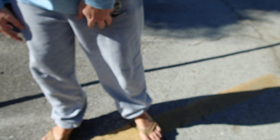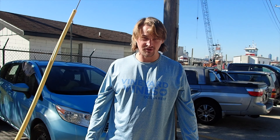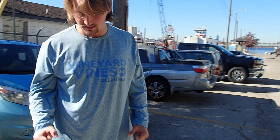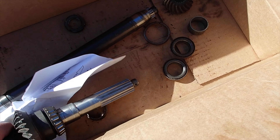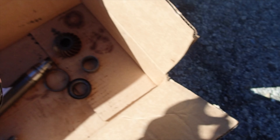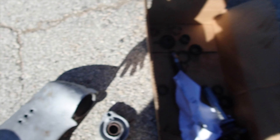Same price as the repair. So what we have to do now is take the paint down, put it all together with the new gaskets and seals, and then, as we learned from the guy at Green Cove Spring Marina, we're going to use the hard sponge to take it back down and then repaint it all. We'll drop it back in, do a little engine test, and hope to God that we don't see white smoke, and get in the water very soon.